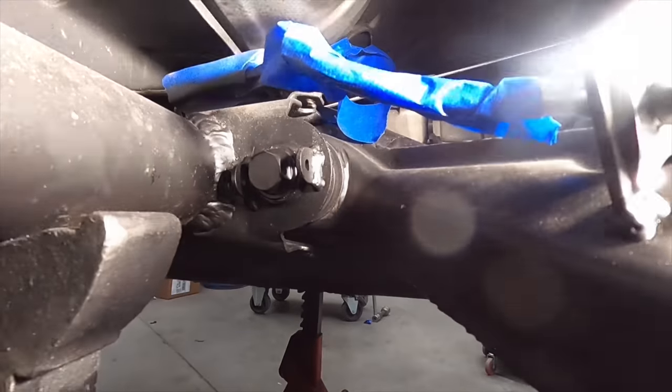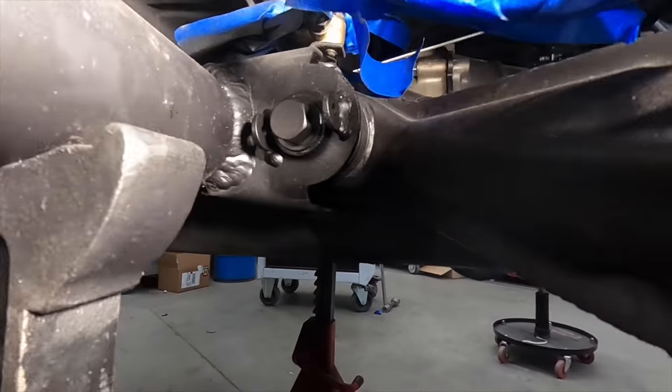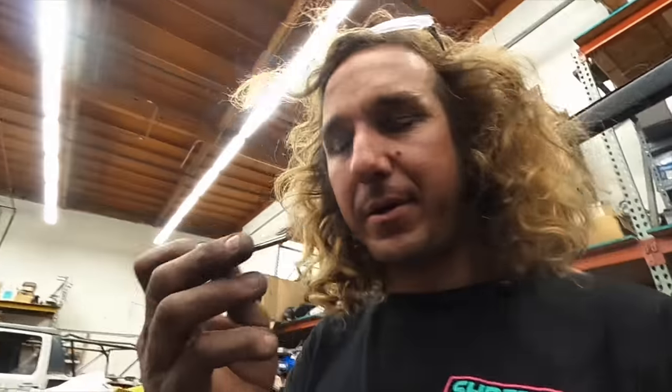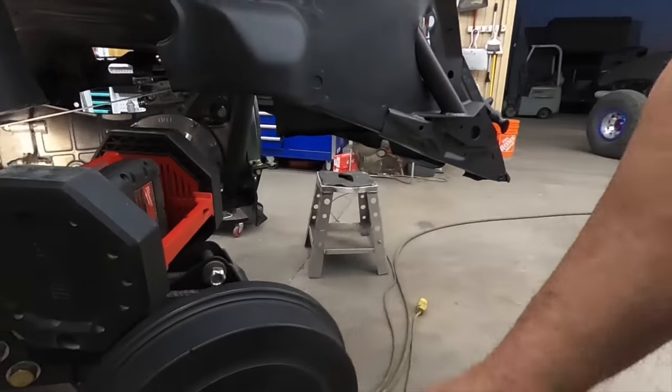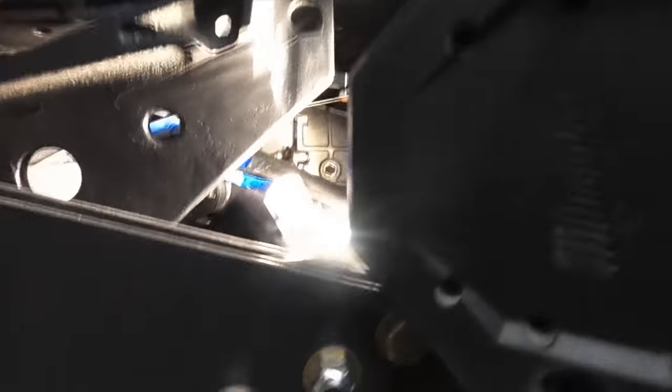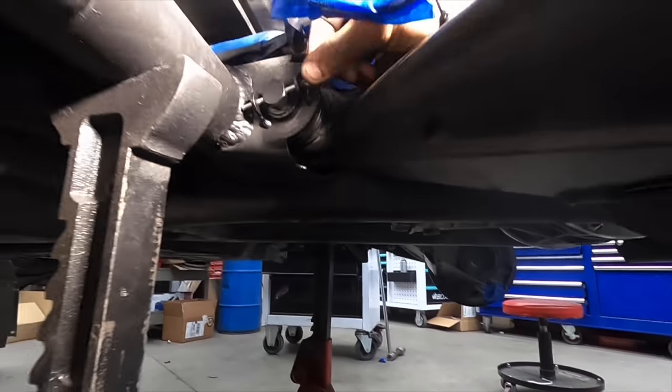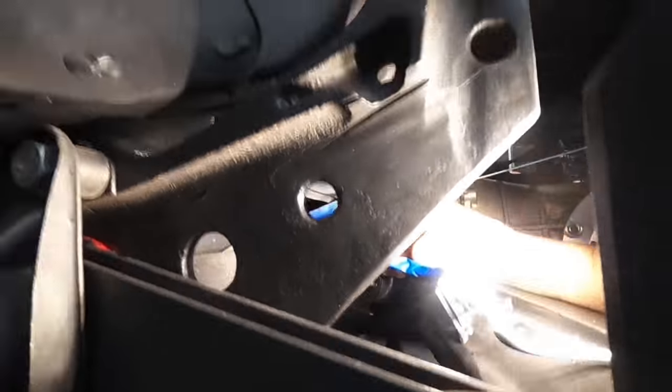You can see the two tabs up in there on each side of the bolt. Let me go grab a cotter pin to show you what's up. I might even be able to use like a 3/16 quick pin, kind of similar to what you'd find on a trailer hitch. Boom — standard cotter pin, something you would use on your axle nut for your micro stubs. Now that that's torqued, I'm gonna put that in there and just flare it out.